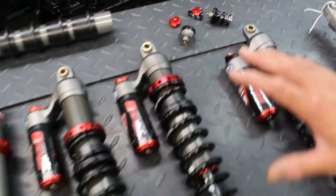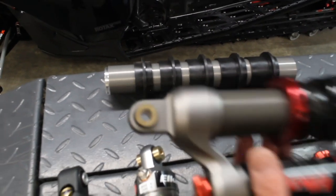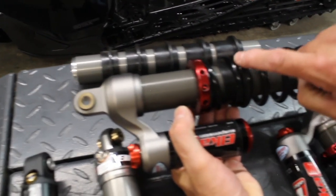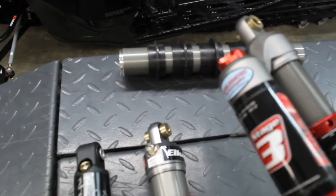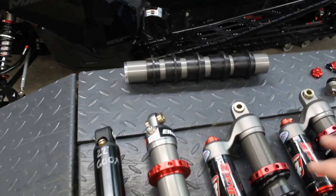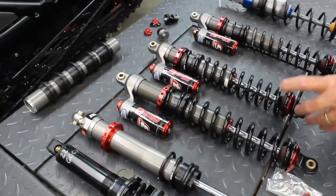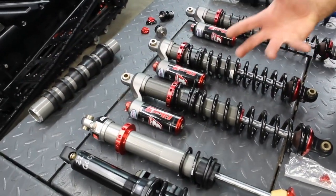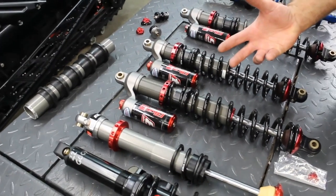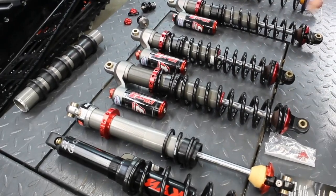The Stage 5 excels at balancing small bump comfort versus big bump protection. We keep five different crossover heights for dual rate springs in the building — you can see the crossover spring here inside the shock. When you order a set of shocks and we install the springs, we pick a crossover height to give you the right amount of soft comfort versus bump protection from the main spring.